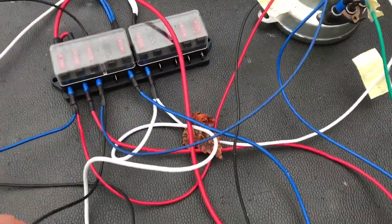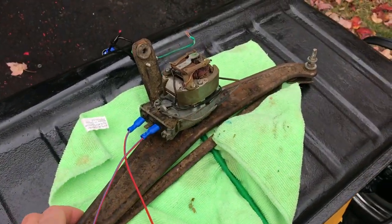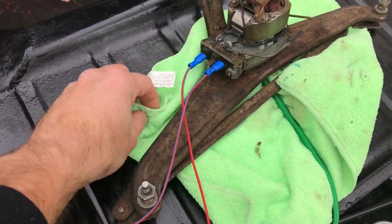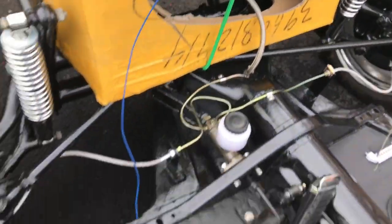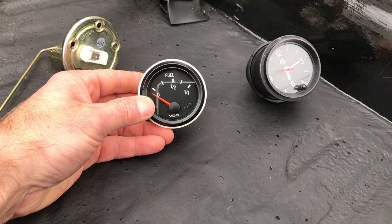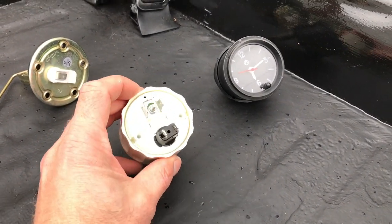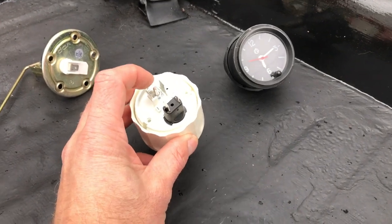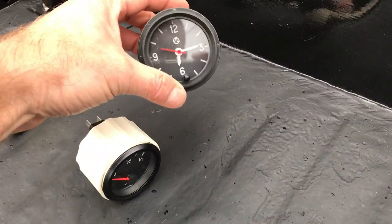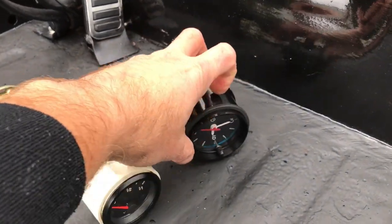From the accessory fuse box setup we have the blue wire that runs to the wiper motor. It's old but it works, so I'll set that up — remove the ground, take both speeds to a separate switch on the dashboard. I'm going to run wires from the extra slots for my fuel gauge. I already tested it with a 12-volt power source — really simple setup. The light on it will connect to the speedometer and ignition switch so everything lights up nicely. I also got a nice vintage-style clock that will be 12-volt battery powered to add a little touch to the buggy.